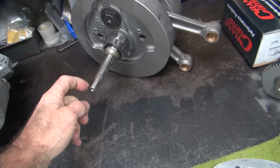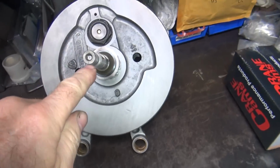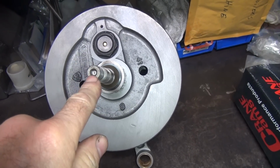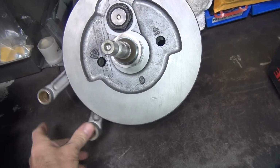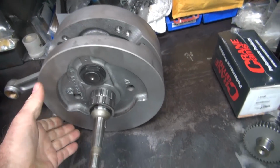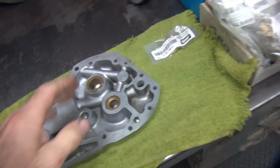So now you want to keep these with just a light oil surface, or you have to go in here. You can see it's got a plug in the crank here. You have to take that and drill a hole in it, and it has to be a really small hole, like around a 40-50 thou hole. That way it can only suck so much oil, and then you usually get oil pressure, but you usually still have to have a high volume pump or something, because even at that it sucks so much oil it kills it. So it's one of those problems we have.